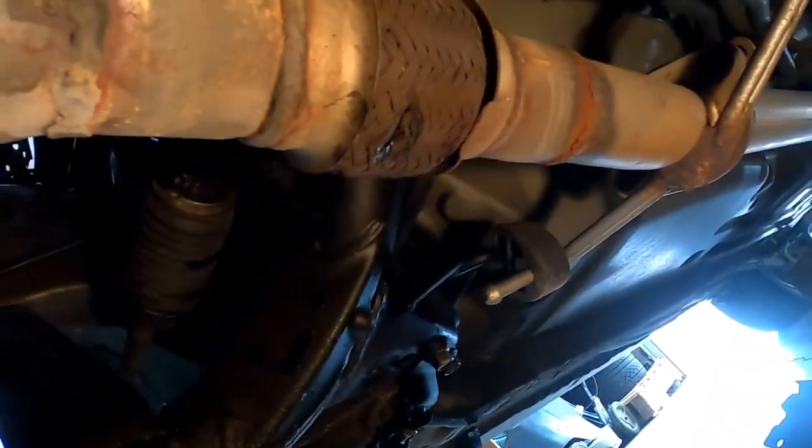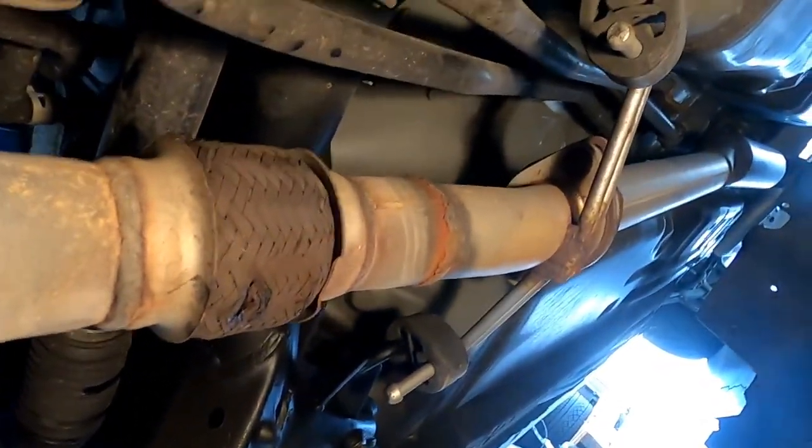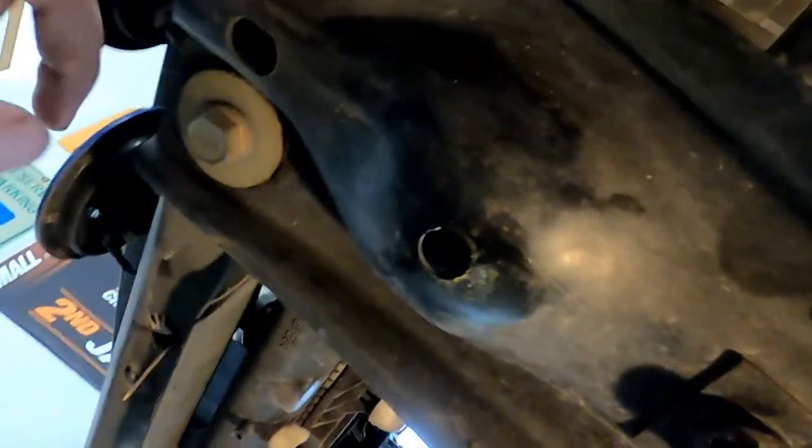If we pulled off that, you can see it laying there. It's just four 17 millimeter bolts. Pulled that off, and now I've noticed my exhaust has been leaking and it's got a crack. It's always something. So next, we're going to loosen these bolts here, and I've already broke them loose on the mount. We're gonna take out these, and they're all 17 millimeter as well.